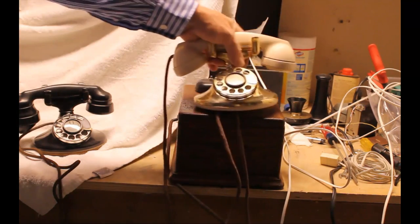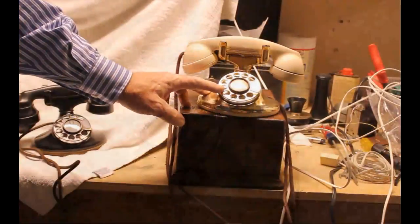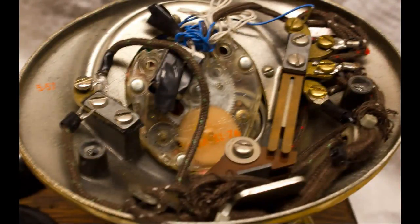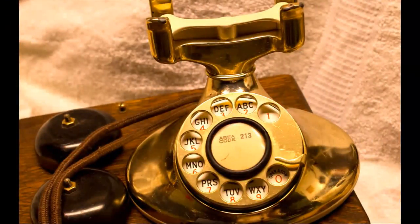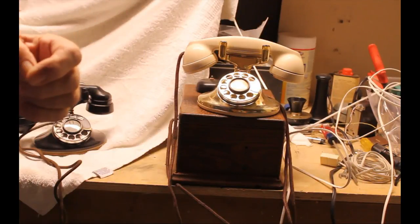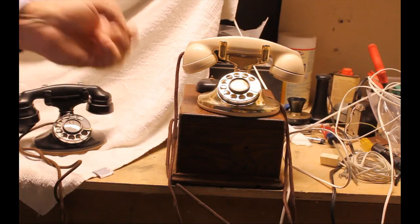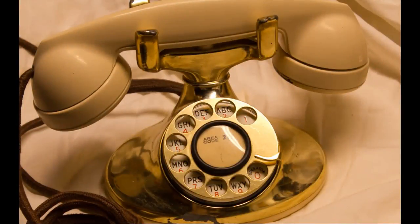And that is no different with this one right here. The dial — when this Imperial set came, this one is from 1957, built in May of '57. The dial had a lot of use on it and the plastic ring was cracked, plus the dial was inoperable. So instead of selling you junk — I really take a lot of pride in this — when I sell you a telephone, you can count on the fact that it will work, because I was a Bell System telephone technician. So I decided to replace it with a 1976 6-type dial. It looks good — it's got a brass ring on it and the dial numbers are clear.